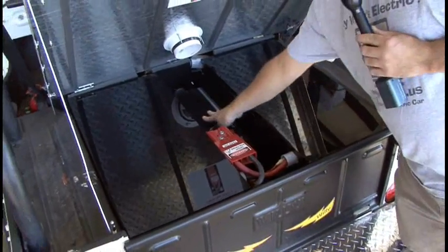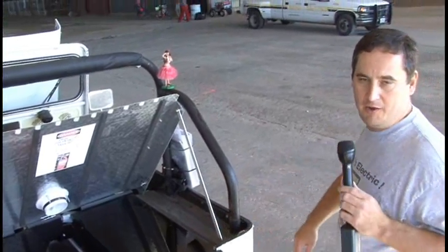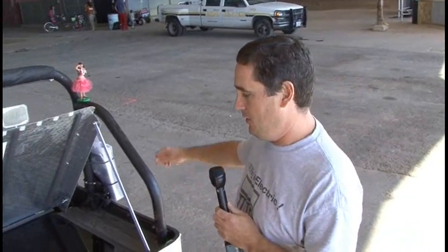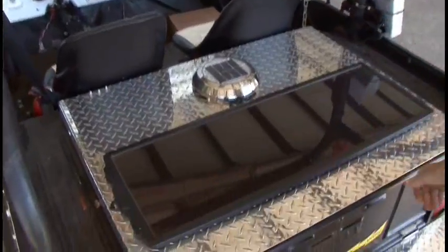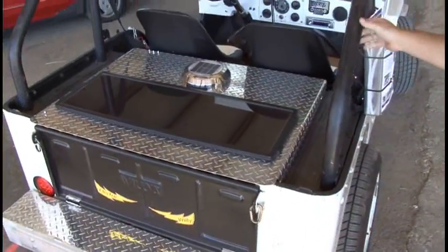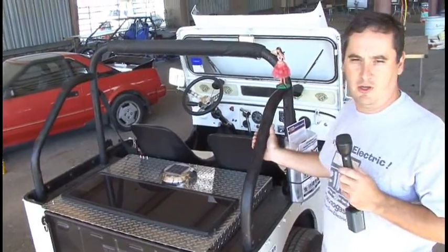They're all enclosed in plastic boxes to prevent any corrosion damage and ground faults from the flooded lead-acid batteries. It has a 500-amp DC motor controller to do the speed control, and accelerometers to detect crashes and disengage the electronics if there's an accident. The vehicle also has some solar power — a solar panel to run all the 12-volt accessories and maintain battery charge for the headlights in the evening, plus a solar ventilation system to pull heat off of the motor controller.